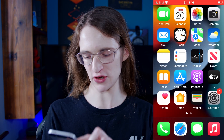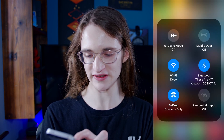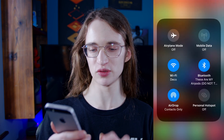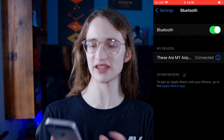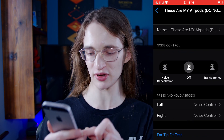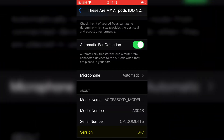But what if you want to just double check that you are wearing the latest firmware? Well, you can actually check on your iPhone. So just swipe up, then hold on the Bluetooth icon right here. As you can see, my AirPods are already connected. Hold on to it again and go into Bluetooth settings. Then you'll be taken to this menu right here. Click on the information button next to the AirPods. Then scroll down and it should tell you which version of the firmware your AirPods are currently running — both the AirPods themselves and also the case, if you just tap on that line once.